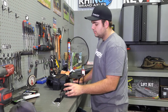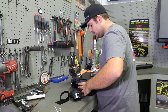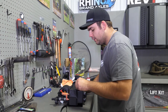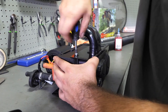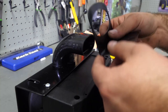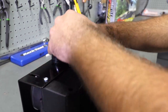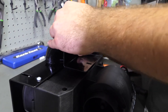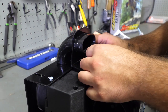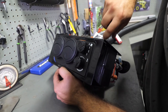Next, we're going to grab our elbow, our heater bracket, our heater, our elbow bracket, and five Phillips head screws. We're going to take our heater, slide it into our bracket, get our elbow installed, and once we have our elbow started into our bracket, get all of our screws started. Flip it over to the opposite side and get all those screws started as well. We'll grab our elbow bracket, work it into position, take our screw, get it started, and fully tighten all the hardware for the bracket going to the heater.